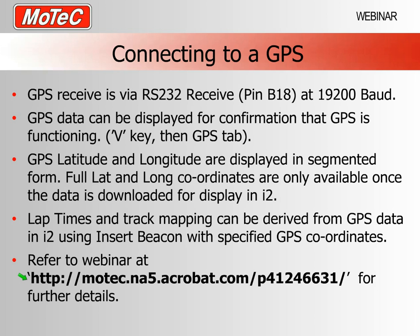All you need to know about how the M84 is used with GPS: there is a preset GPS receive setting in the M84 and no ECU setting is required. If you plug a GPS into the RS232 receive pin at the correct speed, you will automatically be receiving GPS. The easiest way to confirm you are getting GPS data is to use the view screen — press the V key with the ECU connected and on the right hand end you will see the GPS tab showing whether you are getting the correct data. Note that GPS latitude and longitude don't display correctly on the M84 ECU manager screen as the data has been split into chunks, but it doesn't affect how the I2 program works.